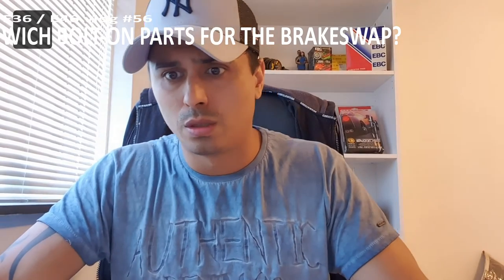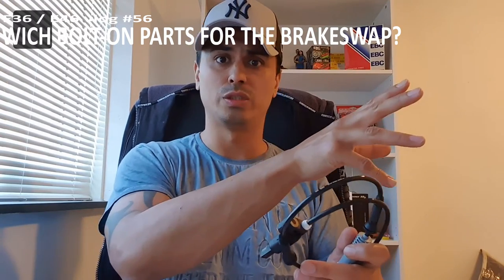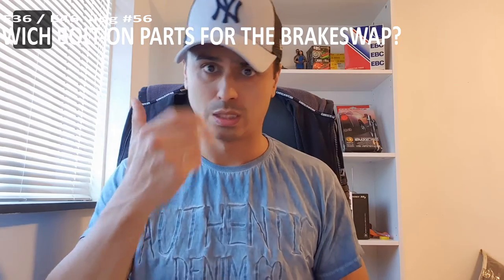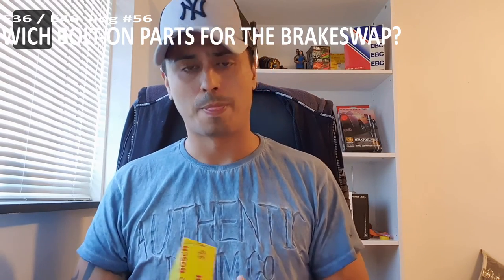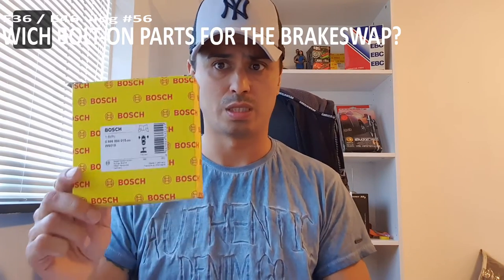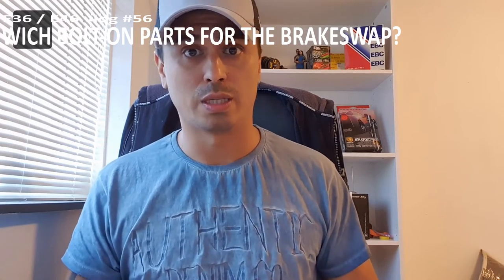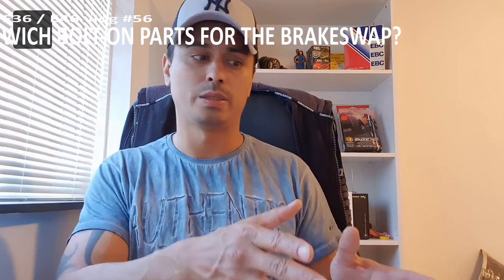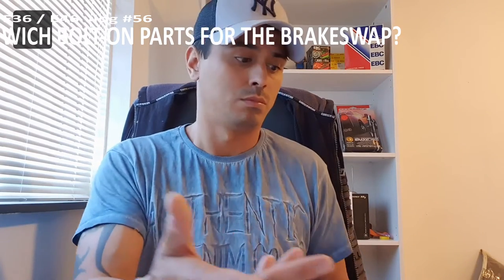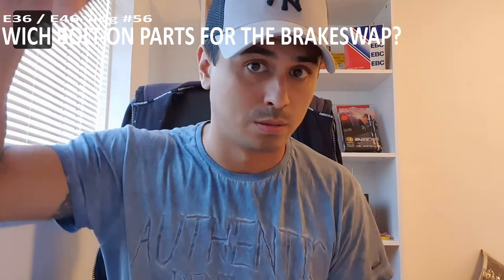Bolt on parts number two: the pulse generator, the ABS sensor. The ABS sensor for the E36 is exactly the same from the 316i until the BMW E36 M3. Also, the part number for the E46 is exactly the same as the E36, except the 330i one. One tip: don't buy original BMW parts. Look on Real OEM or other sites and see what manufacturer made that specific part — in this case it's Bosch — and buy that part directly. It's a lot cheaper. I'm not saying buy cheap knockoffs; just buy from the actual manufacturer without the BMW logo on it.